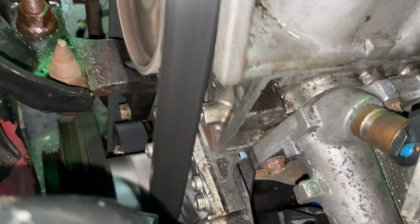The injectors I got out of the junkyard were out of the same motor, D16Y7. They had a green tip. All these have an orange tip. So I wonder if these are the wrong injectors for the car. So we're gonna take it for a ride and see what happens before we change the distributor part. Oh yeah. Way better.